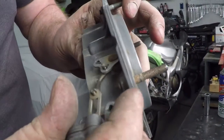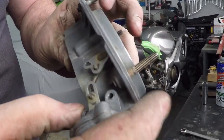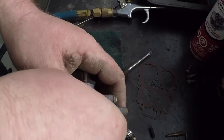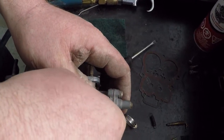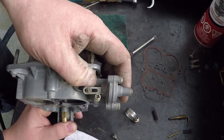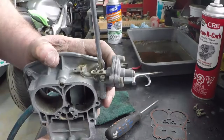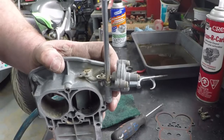Once you have that, lift it up into place. There's a little trough. You can turn it. Now you can put it in the spot, put the screws in, and go. The holes in this aluminum are not fully cleaned out from machining, so you have to thread them in the whole way instead of them just sliding down in place. Mildly annoying. And again, you don't want to tighten them up too much, just snug them up good.